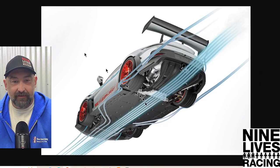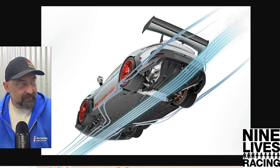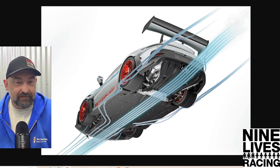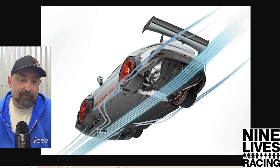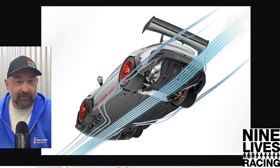I want to jump back and have some educated guesses as to why Porsche and other cars have done this. Knowing what we know now, I think Porsche is limited on their front splitter size — it's a small splitter; it's got to be a road car. You've got to drive through stuff, go through shopping malls, hit raccoons. So I think instead of having a huge splitter — because they've got a massive wing and a massive diffuser — they added a bunch of these to get the front downforce back up. That way they didn't have to run such a crazy splitter on the road car.